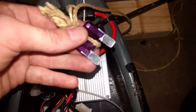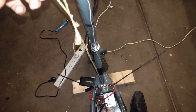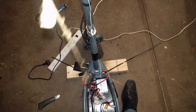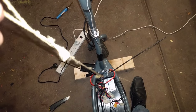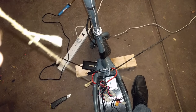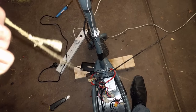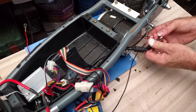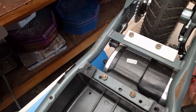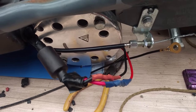Now a demonstration of how this is going to work. Here we have the 100 amp fuse with its cable tied around it — pop that in, circuit's complete, we can run the scooter. We have our little safety pull, and oh no, we're having an accident — it drops straight out, which is awesome. I'm a little bit worried that the fuse comes out too easily after testing it five or six times, since this is a fuse holder, not meant as a quick release. But frankly, I'd rather have the scooter not work because the connection is too tenuous than be flying at 40 kilometers an hour with it stuck. Motor direction check — that is spinning the correct way, spinning forward. The motor is all wired up. It is now time to break the chain.